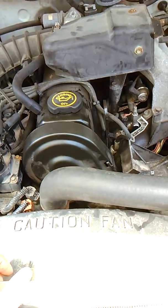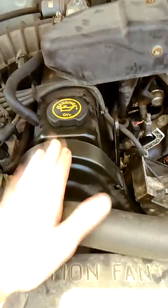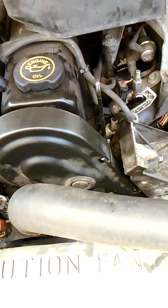There are some good videos on YouTube on how to do the complete job, but they left out this little tip. Just make sure you're matching triangles on the camshaft pulley, and on the oil pump pulley you put triangle to diamond, and then your crankshaft at top dead center.